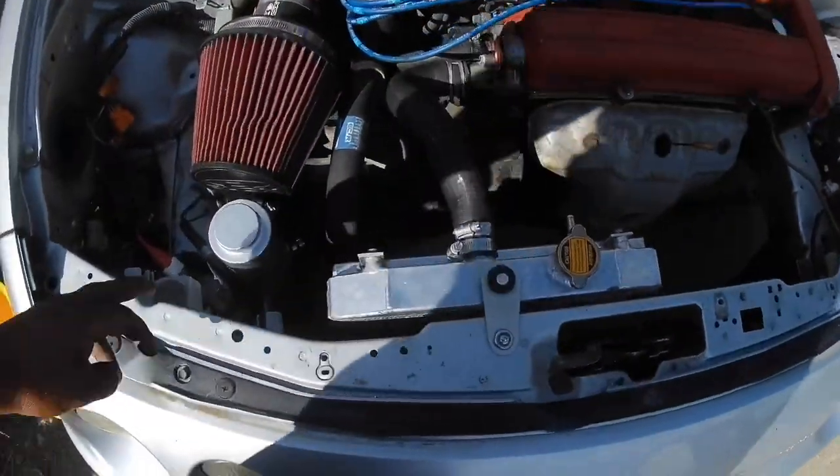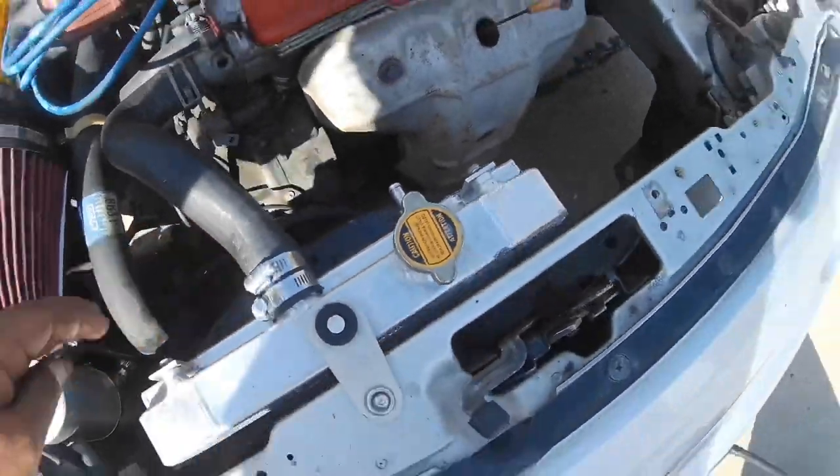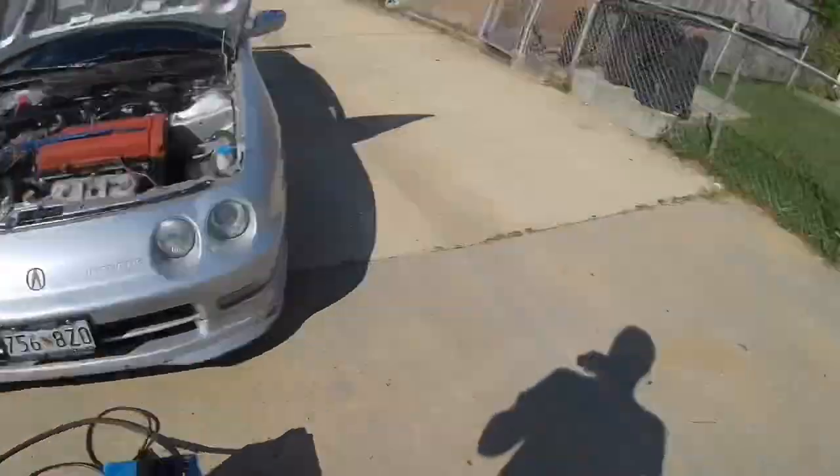The radiator is all installed and bled. I still have to pick up the hose for the overflow, but it was pretty easy to install. The only thing you really have to worry about is welding one bracket, but you could just use self-tapping screws if you don't have a welder available. When the thermostat came on while I was bleeding it, the fan definitely kicks out a lot more air than the stock one. The temperature seems to be around the same, but I'll see how it performs once I start beating on the car. The reason I did install this half radiator is because I'm picking up the PLM header, the BZ style, and you can't use a full radiator with that because it comes out too far towards the core support. If you have any questions, shoot me a message or leave a comment below - I'll definitely get back to you. Until next time guys, like, comment, subscribe, and I'll catch you in the next one.